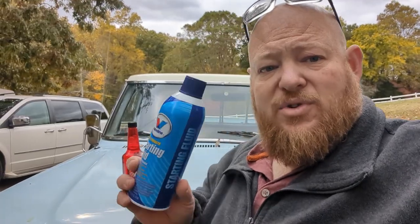And then the other thing I thought was, we probably flooded it yesterday because the carburetor's pouring gas. So if I cut the gas off to it last night, and it's had a chance to dry out. So I thought we'd pull the plug, put a little Marvel Mystery Oil in it, and then put the plug back in and shoot a little starting fluid in it. I just want to hear it pop off. If it'll pop off, I'll be a happy man. We can order parts, get the things fixed, but I just want to hear it run.